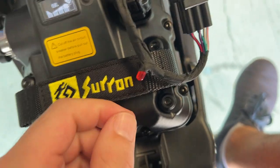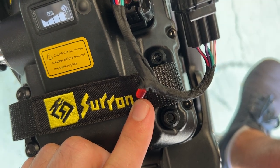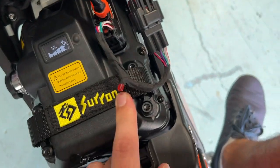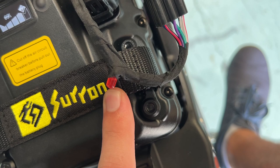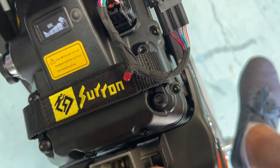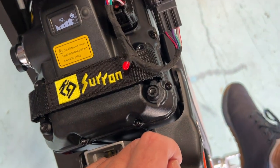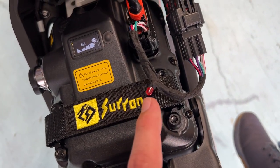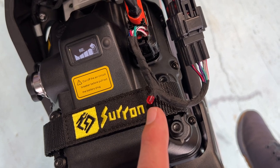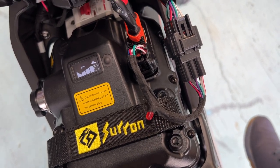Okay — flash, flash — 1, 2. See how there's a long delay between flashes? That means your bike is normal and there's no issue. So we want to find the number of flashes when there is a fault. If it's flashing very slowly like this, that means all systems are normal.